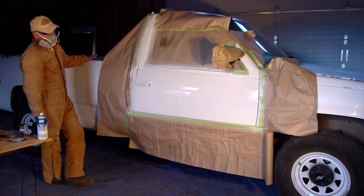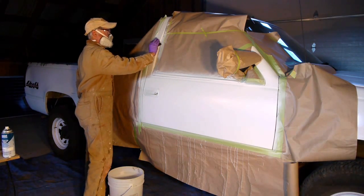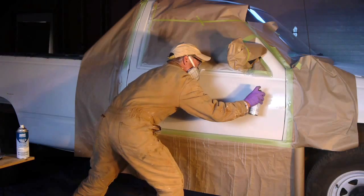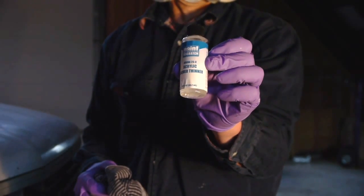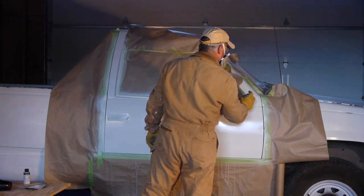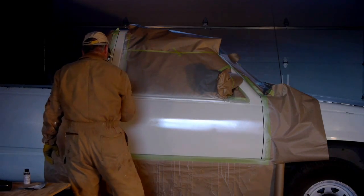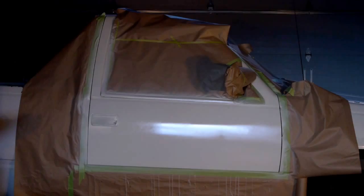If you have any paint blobs or runs at any point in the process, let them dry and then wet sand the uneven paint using 1000 grit sandpaper or the rubbing compound. After the imperfection is smoothed and dried, resume spraying the base coat until you have an even and fully coated repair. If you make a large mistake, you can use the automotive lacquer thinner to wipe the paint away and start over. The goal of the base coat is to completely and evenly coat the damaged area, and to have blended fresh paint within the larger undamaged area without any noticeable paint lines. Check your work often and do not rush.